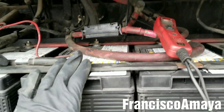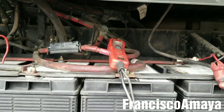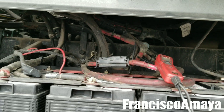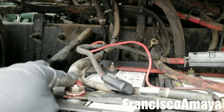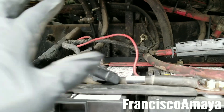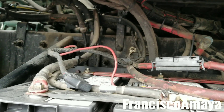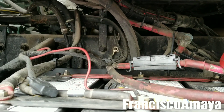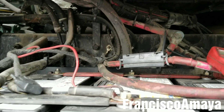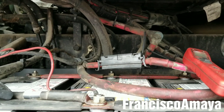You have to inspect the batteries and all that. The main source of no power in the cabin, or no power at all, is usually the negative cable of the power source — it doesn't matter what type of vehicle it is. The negative power source is the one that gets corroded the most, gets weak most of the time, the cable gets damaged, and all that.